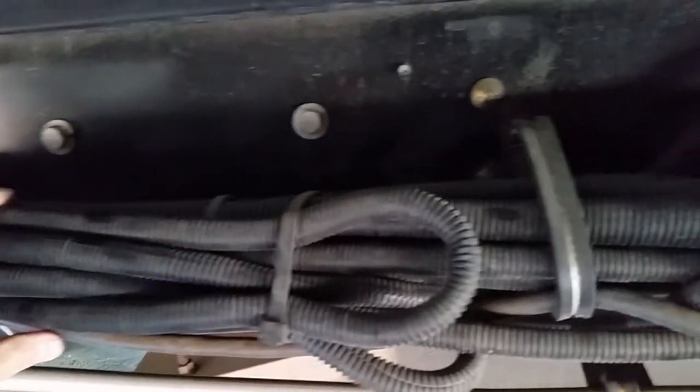So that was something I learned. Something else I learned about was the equalization cylinder, a little bit about how that works. Underneath here, there's a shaft right there. The room is extended now, but as it retracts, this shaft will also stick out here another foot or two. And the equalization cylinder's job is to make sure that the fluid going to the forward and the rear cylinder is the same amount.